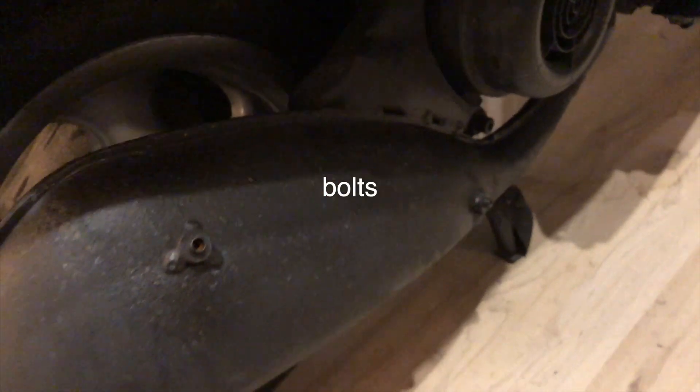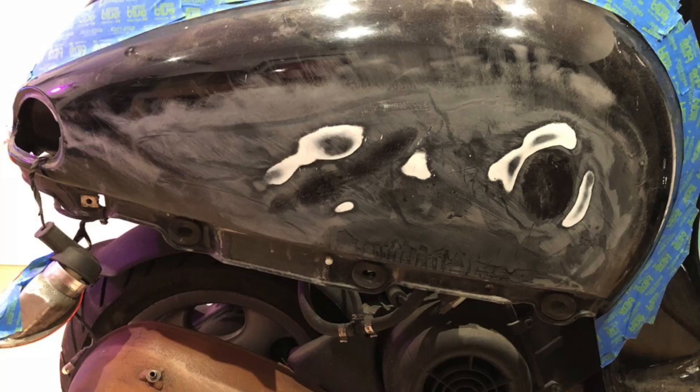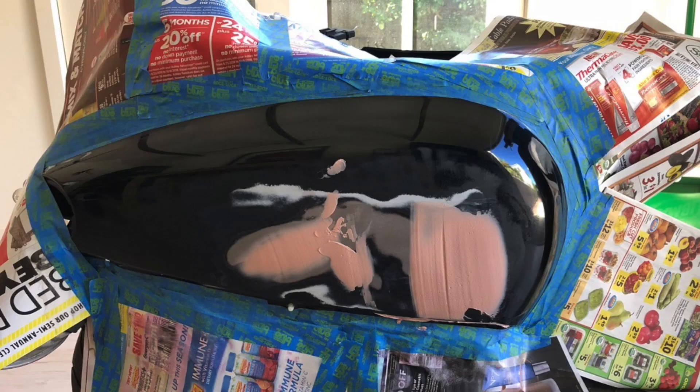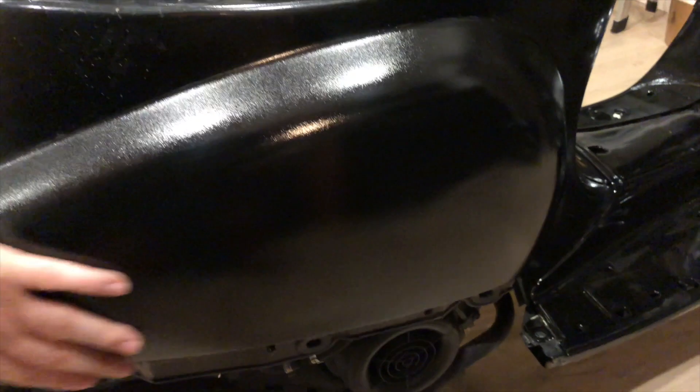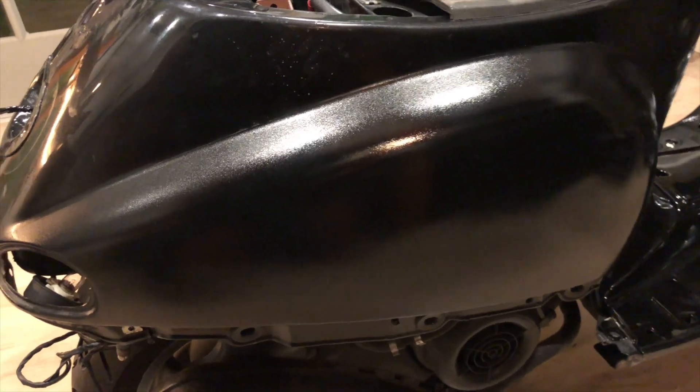Today I just cleaned it off and ordered a couple of nuts and washers for fixing on the heat plate. I've also done some work on this panel — it was dented in, and it already had some dents when I bought it: a big dent, a new one, and a couple of scratches. I used some Bondo, smoothed all that out, and sprayed it. One thing I've noticed since spraying — I've been using aerosol cans, I don't have a spray gun — is that it was great for the colour, but when I put the gloss finish on it's got all these little fine dots. It feels nice, it's kind of a matte finish, but it's different from the original body paint.